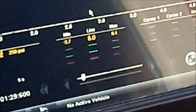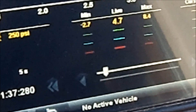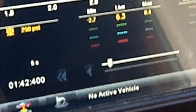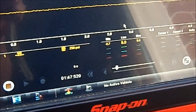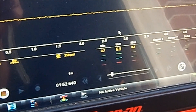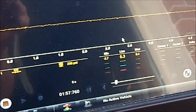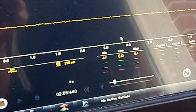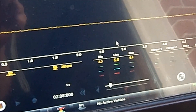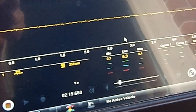After going back and forth with the adjustment and doing a lot of engagements, we are at five pounds. It goes a little bit under when the idle drops, but we're in between five and six pounds now — that's where we want it. It just needs to be test driven and it should be ready to go. It's better to do the adjustment in drive, bring it to five pounds in drive, then cycle from park to reverse, reverse to neutral, neutral to drive a bunch of times, look at your pressures, and go from there.